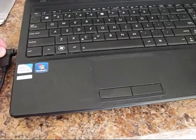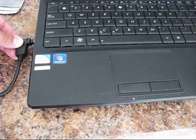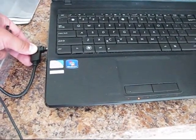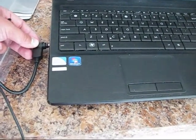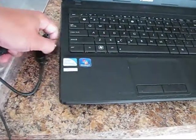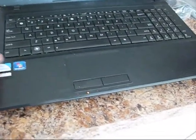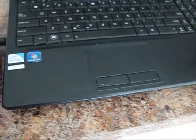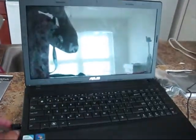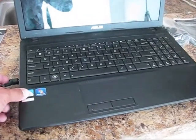If we pull the connector down, it starts charging the battery. As you can see, you have to manually hold it — it means the power jack is loose. At the beginning, I thought it could be a faulty power adapter tip, but then we found out it's the jack on the motherboard which is bad, because this happens with different adapters. And it's becoming worse and worse — you have to hold it every time to make it charge. That's why this ASUS X54C has to be taken apart and its power jack has to be resoldered. A new replacement is needed.